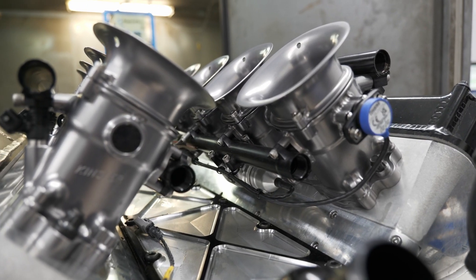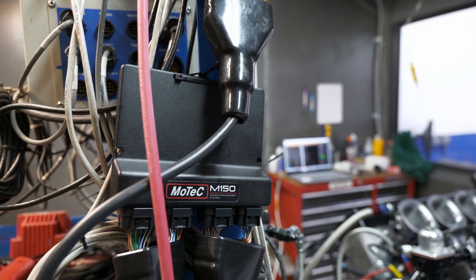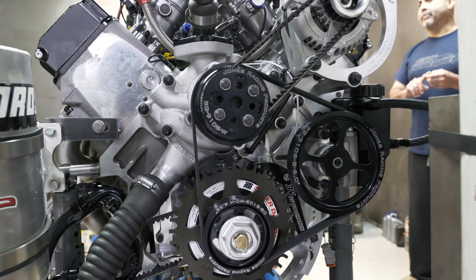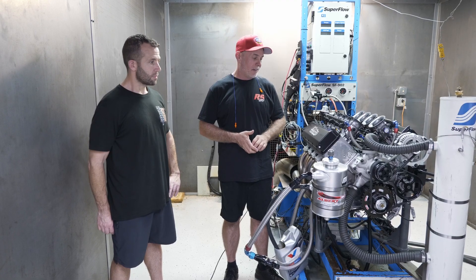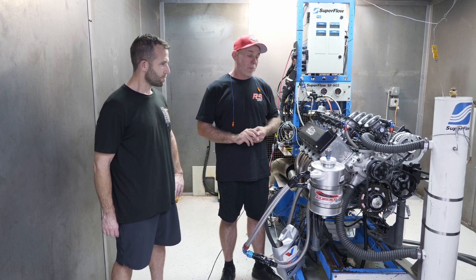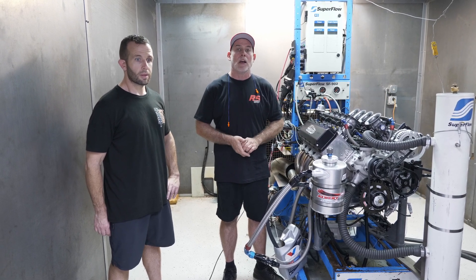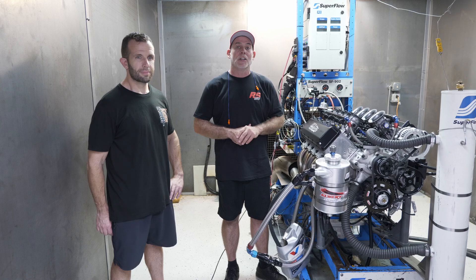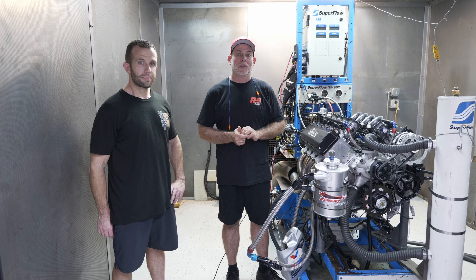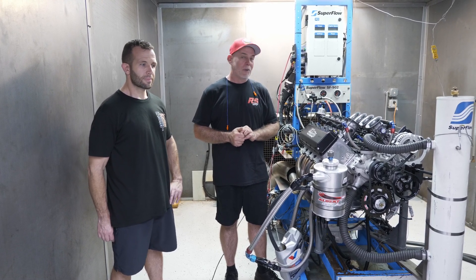It has Kinsler stacked injection, dual drive-by-wire, Motec ECU, dry sump oiling, and a Jones drive on the front. The engine should make north of 900 horsepower on the dyno — speculation is anywhere from 900 to 1050. Pretty exotic piece. And what's cooler is Jobe has an RY45 going in his 66 Mustang, so two old school American muscle cars with two fairly exotic naturally aspirated engines, and we're going to make some noise.